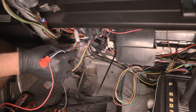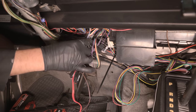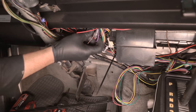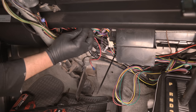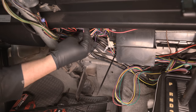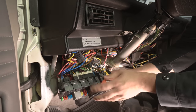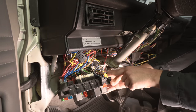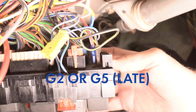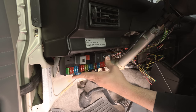The white four-pin connector and the red two-pin connector are for the control switch. I like to route these wires up under the instrument cluster near the master cylinder. The female quick-disconnect brown and red fuse wires are the system power supply — they go down near the fuse panel. Pull the fuse panel down to access the rear of it, then finish routing the fused brown and red wire and attach it to fuse panel position G2 or G5 on late model vans, or at the bottom of fuse 10 at the back of the fuse panel on early model vans.